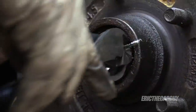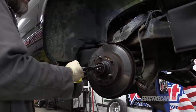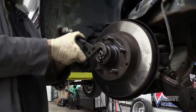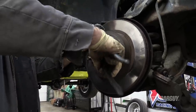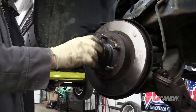That looks like an actual cotter pin. Oh, this is a no-no — somebody tightened this like I should be able to. Because when you tighten these down, it's just like a boop. You don't want any preload on these bearings. Bearings are getting replaced.